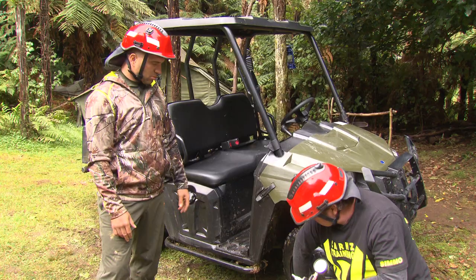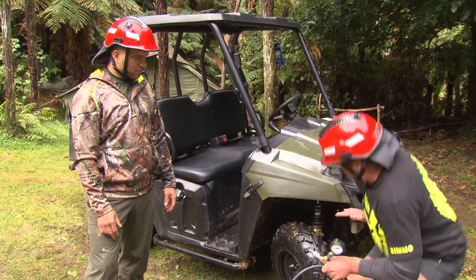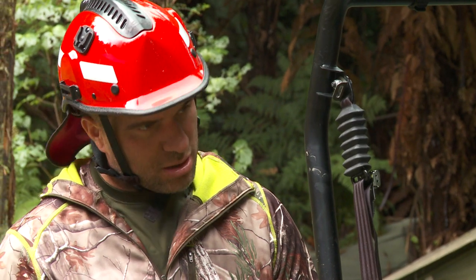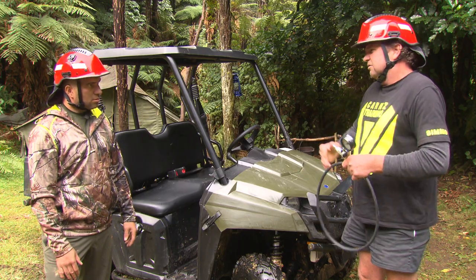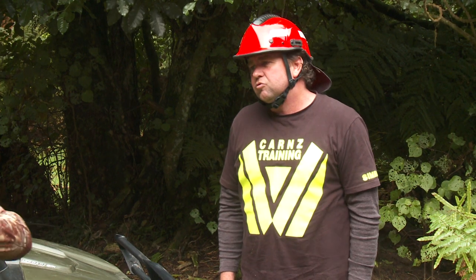It's all about traction. If the tyre's too hard, these tyres are designed to flex and mould to the shape of the ground — you can see that movement there. If you have too much pressure in there, that won't happen. It'll skid up over undulations in the ground, we lose traction, we get a harder ride, and our ride comfort and capability is compromised.